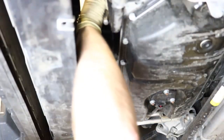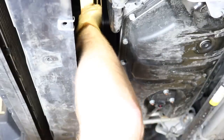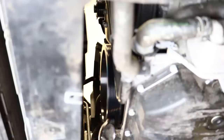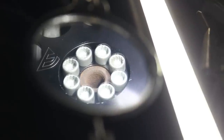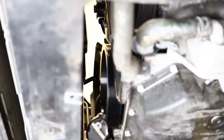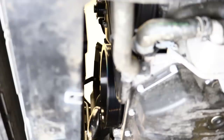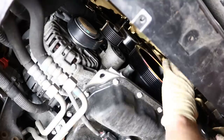When installing the pulley make sure you have it oriented correctly and make sure your belt is in place before bolting it down. A very helpful tool here is a mechanic's mirror combined with a light — you can use the mirror to see the bolt holes and determine what's lining up. If you don't have a mechanic's mirror, a makeup mirror works great. This is extremely helpful because otherwise you're essentially working blind trying to thread the bolts in.